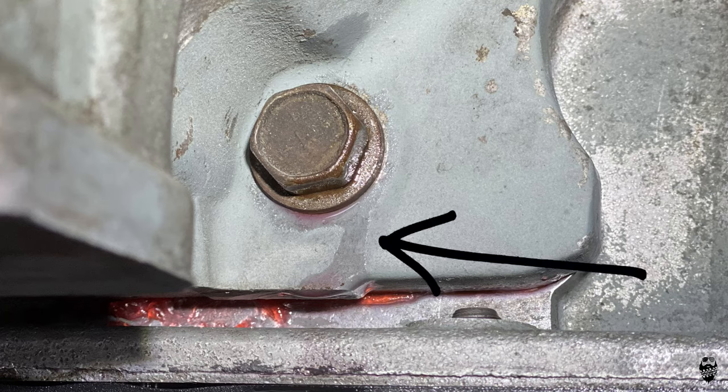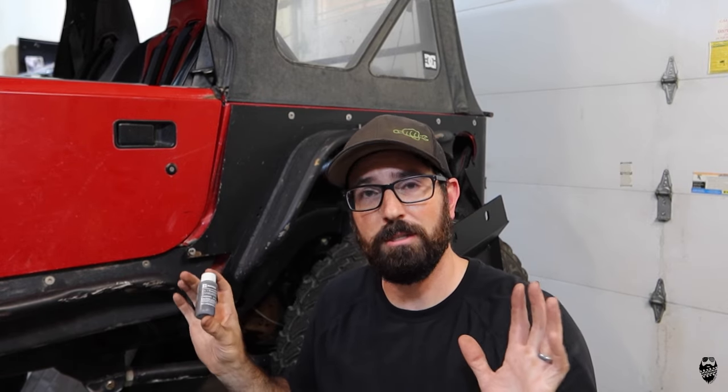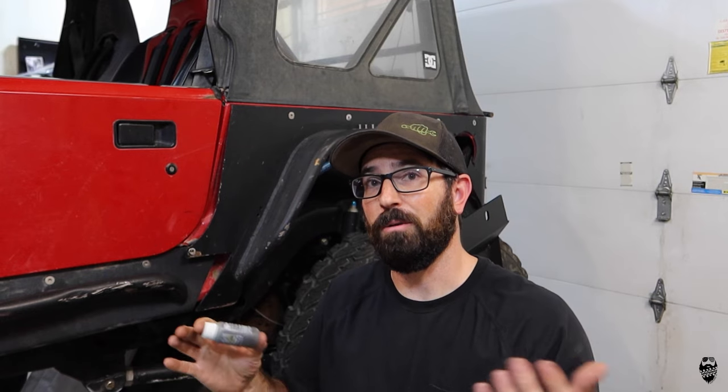The foot spray, in this particular case and this spot, didn't really help me out that much. Just cleaning it really well and checking every six or eight hours was how I was able to find this. I did put a little bit of transmission fluid on the bolt and took a picture — you can see how the oil kind of pushes it away and you can see a line where the white foot powder is. So it definitely will help in diagnosing where oil is coming from, just not in my particular case. In conclusion: does it work? Yes. Is it the best? No. UV dye with a UV light is your best bet, but it's more time consuming and costs more to set up. This is a lot cleaner and less messy than baby powder for sure.